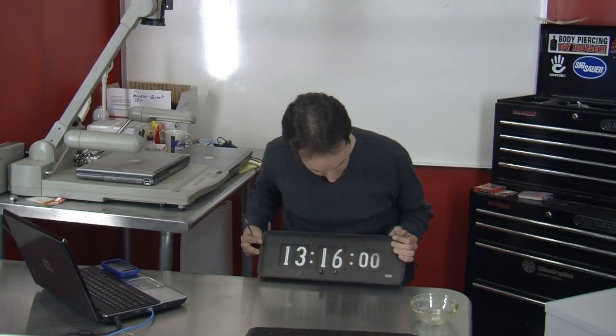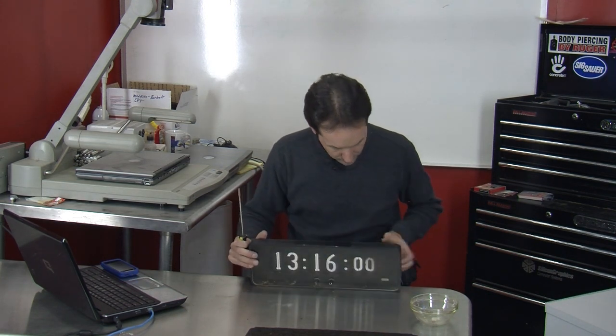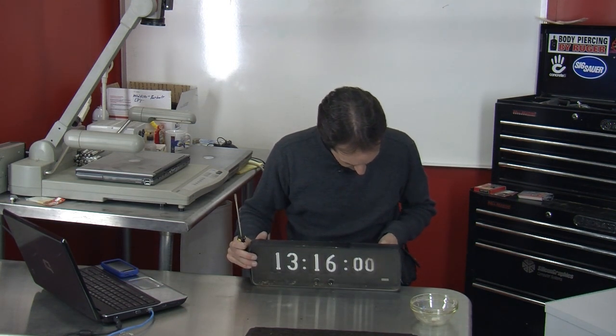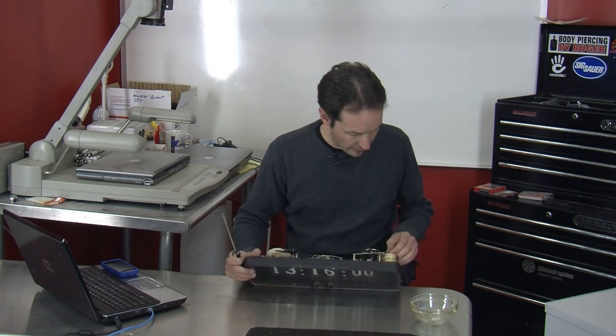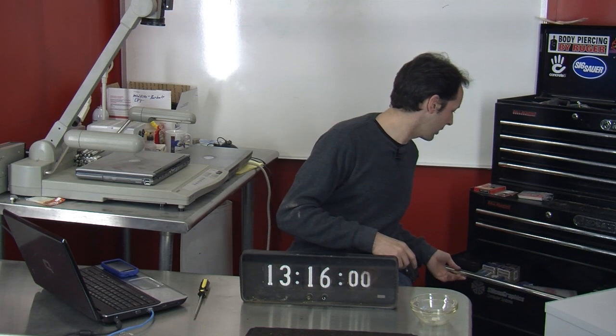What do we got? We've got hours, minutes, seconds. The synchronous motor turns it. Let's see if we can just power this up. Safety first — we'll cut off that ground, don't need that. We'll strip these leads down. I've got the two connections on the back here and there's no color coding to them — it's just straight-up AC. I'm going to thread the wire down inside the connection and then physically crimp the connection down onto it.